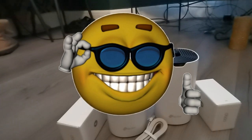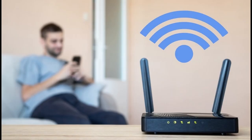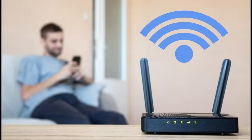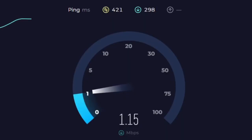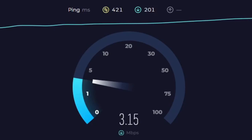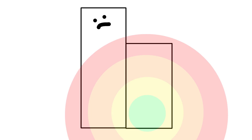Overall, I'm very happy with this system, and I'm honestly surprised by just how well it works. But should you buy one yourself? Well, if you're having issues with your speed, it's important to know whether the problem is your internet connection or your Wi-Fi connection. An internet connection is the connection between your home and your ISP, while a Wi-Fi connection is the wireless connection between your device and your router. If you find that the speed is fine near your router but weak in other parts of the house, it's most likely an issue with your Wi-Fi connection. However, if you have connection problems all over your house and even a slow connection over ethernet, it's most likely an issue with your internet connection, and your best bet is to get a different internet package and possibly a different ISP. It's also possible that it's a device-specific issue — for example, if your wireless device doesn't support 5GHz or newer standards like AC or AX, your speed is going to be limited on that device regardless of how good your Wi-Fi setup is. But in my case, I knew the problem was in fact a Wi-Fi problem, and that's why I bought the mesh setup.